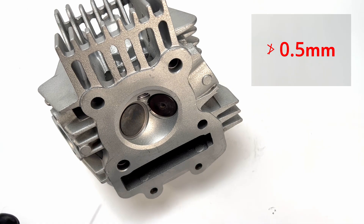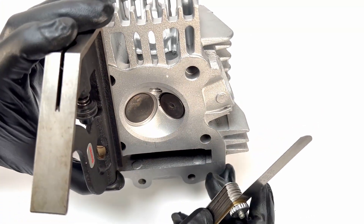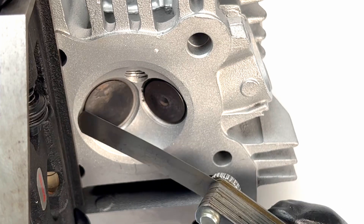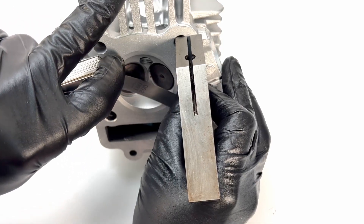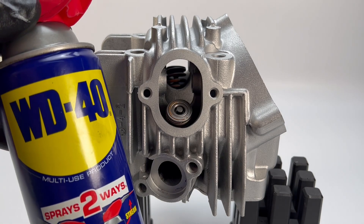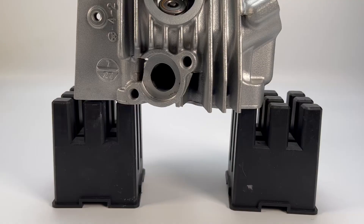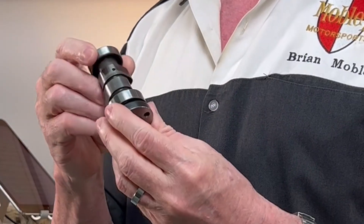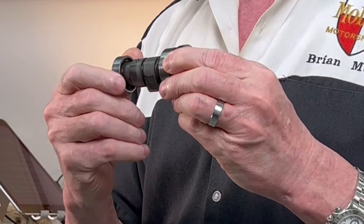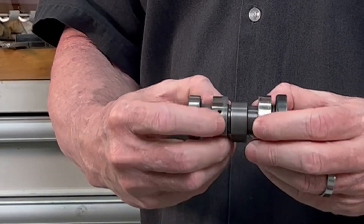Using a machine flat surface — in this case, the base of a Starrett combination square — and a 0.5 millimeter feeler gauge, check for possible gaps by attempting to pass the feeler between the indexing surface of the square and the base of the head. Once you've checked the warpage, a simple way to check if your valves are sealing is to take something like WD-40 and spray some into the port, then just look to see if any of it leaks. If the valves don't leak, it's time to go on to the camshaft. On a camshaft, you want to inspect the bearing — make sure it spins freely — and also be sure there are no burn marks or any kind of unusual wear on the lobes of the camshaft itself.